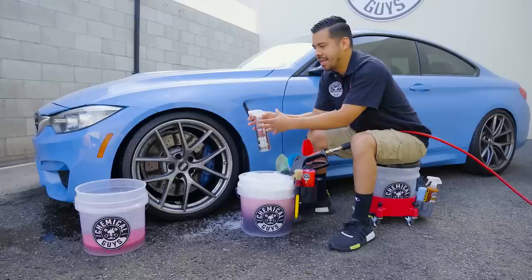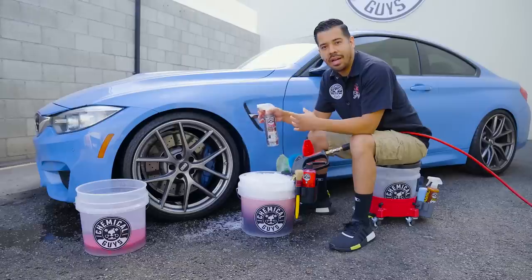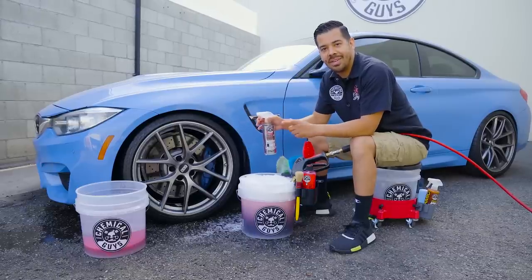So I'm gonna go ahead and spray this down, give it about a minute and a half to 2 minutes to just kind of dwell and break down any kind of iron particles. And then we'll be right back with you guys to finish cleaning the wheel.